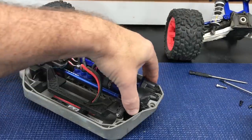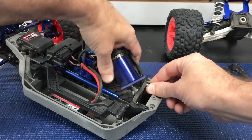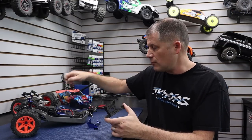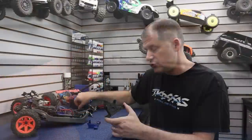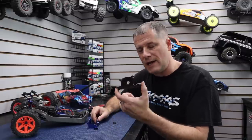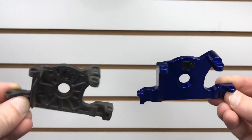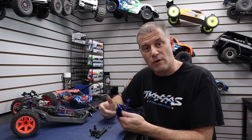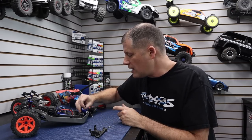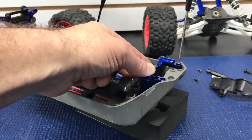It's just a single screw that holds on the gear cover and then four more screws that hold the plate to the chassis. You're also going to have to remove the 2.5 millimeter screw that secures the motor plate to the motor mount. I'm using Traxxas tools — I have a ball driver from that tool set, which made getting that screw out pretty easy, and then a 2.5 and 2.0 millimeter straight bit for the rest. Make sure you clean everything before you install your new parts — clean off your bearing, wipe out any dirt on the inside of the chassis. Then put all the factory hardware back in and go ahead and put in the center differential.